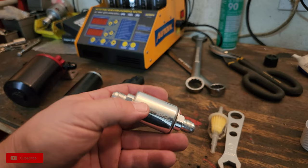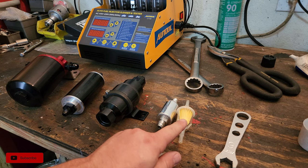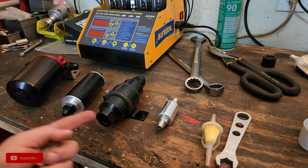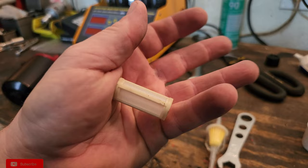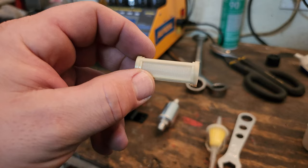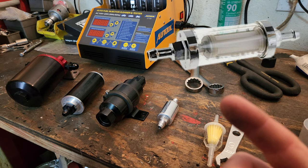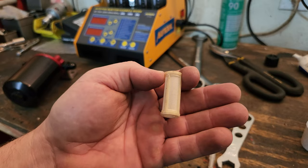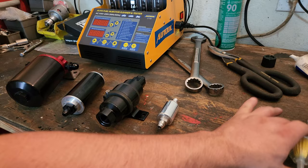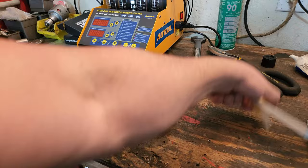In my 2276 naturally aspirated engine build, I relocated my filter there as well but used a canister setup — I didn't know they made ones with 6AN male fittings already on them. Still a good buy if you're running all AN lines. The next upgrade is a regular metal canister — sealed, no problems. I also see some people using a glass filter screen setup with two ends that screw together, but that's not safe at all. I ran one for about a week or two and the vibrations caused it to loosen up and leak. I don't recommend those filters.